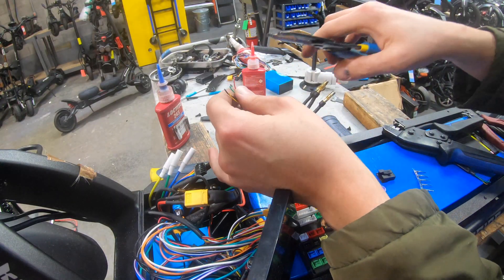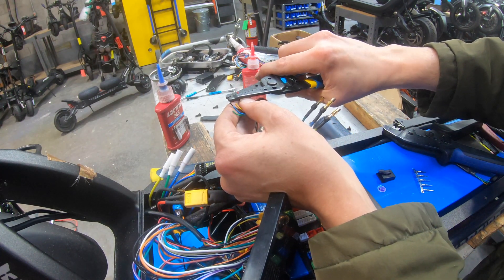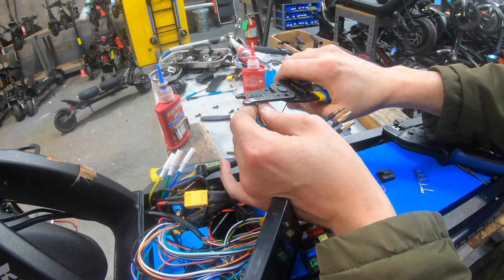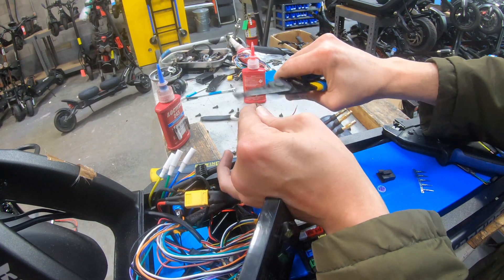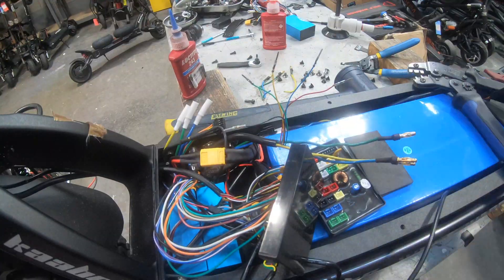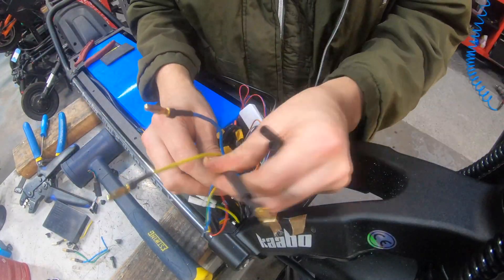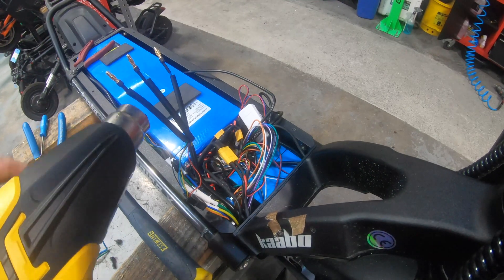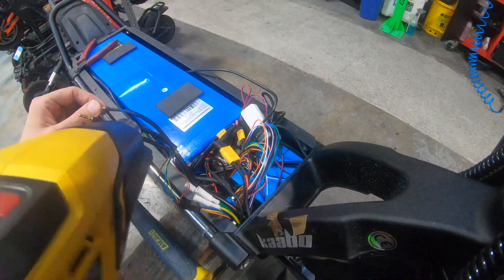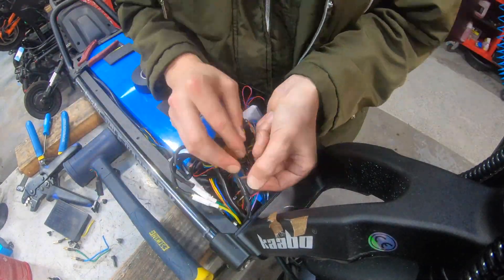With the new motor mounted and the cable run through into the deck, I need to rebuild this JST connector for the motor halls. These wires help the controller time the pulses to the motor. Crimping and building JST connectors is going to be its own video, so if you're interested in that, be sure to like and subscribe. In my experience, the insulation on these motor phase wires can break down and become problematic, so I'm going to add some additional heat shrink over the ends here.